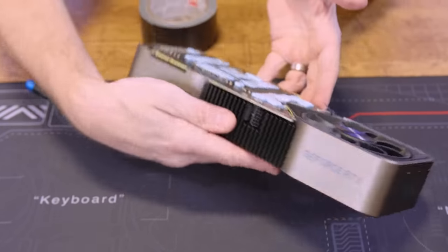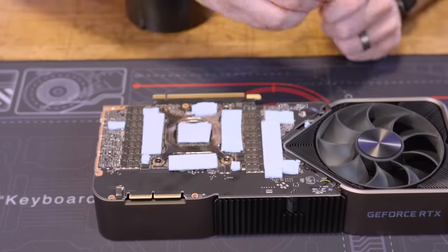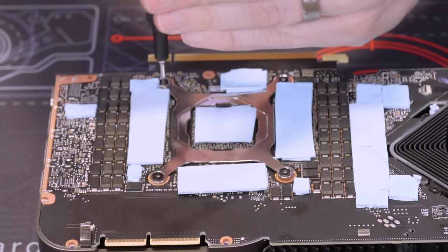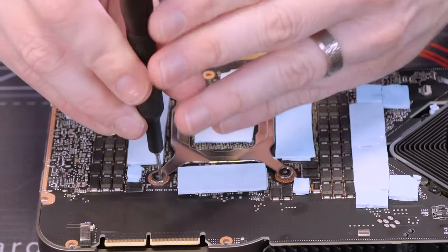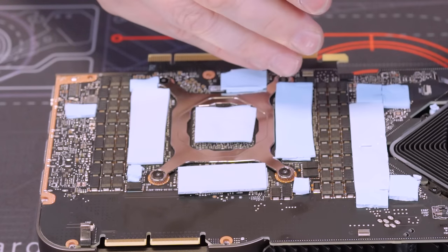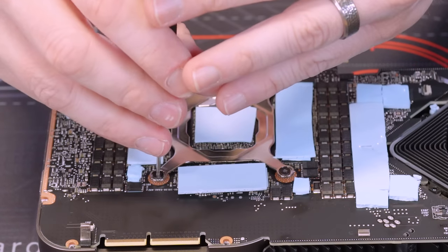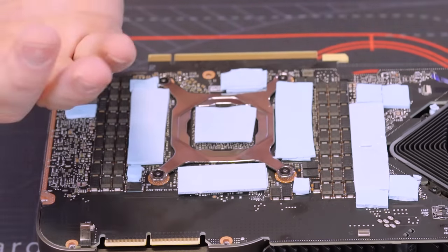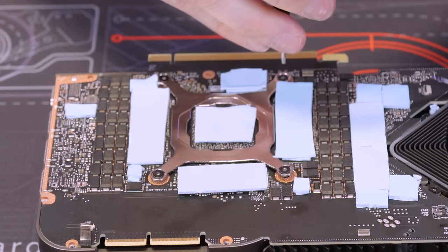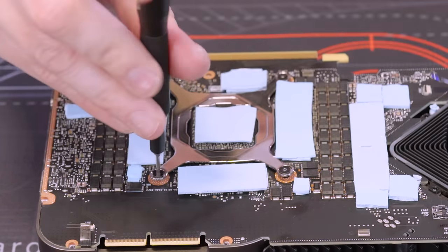Now that we've got that off, the only screws holding the cooler on now are the T screws — those are probably going to be like a T2. And this is going to be true for any 30 series card: 3080, 3080 Ti, 3090. They learned that the size of the die required a lot of tension to keep the cooler flat against it, that's why this bracket exists. I'm just making my way around slowly loosening it up — otherwise if you just do one side it'll go bang, then you do another side it goes bang, and it's just a lot of force you don't want. You don't want it to suddenly snap the cooler sideways in some weird way, not to mention it'll keep this from launching a screw across the warehouse.